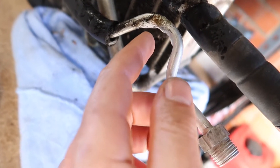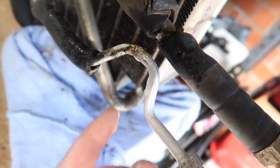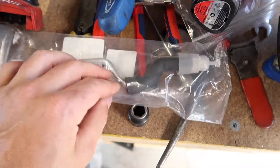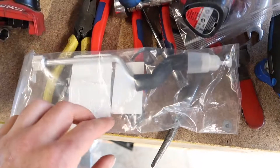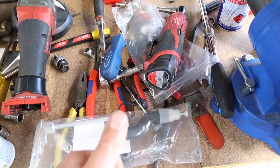As you saw, the bubbles came out of here — there's actually a crack through here. I've got a new pipe for this from Toyota, along with new o-rings to go with it. So it's going to be good to have air con back as well as heating.